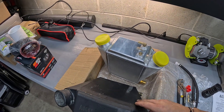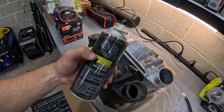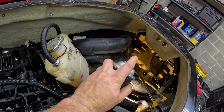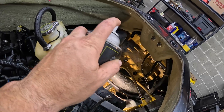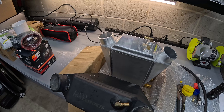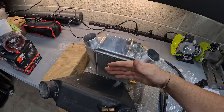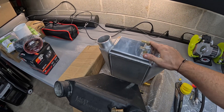Just like every other time I do intercooler work, I'm going to spray the pad that the intercooler sits on with some anti-corrosive lubricant. When the intercooler is in there, that shelf underneath is not going to get the rinsing that we normally have when spraying the ski down after saltwater rides. So the easiest thing is to spray the whole area with anti-corrosion. It gives the intercooler a fighting chance because salt water can get underneath and just sit there — it won't dry out, and when it does, you're just leaving a salt surface. A lot of intercooler failures, if not internal, are external breaches from sitting on a salt shelf that never gets flushed.